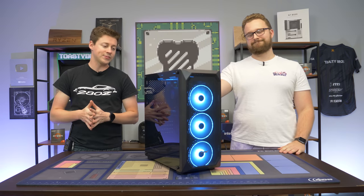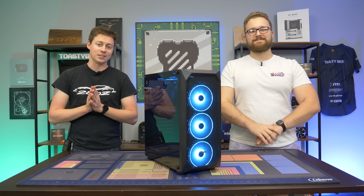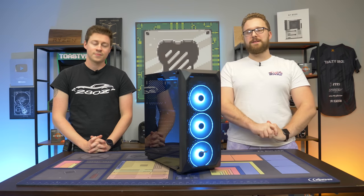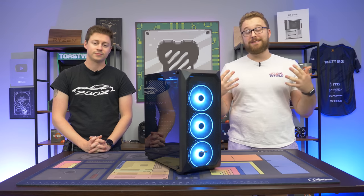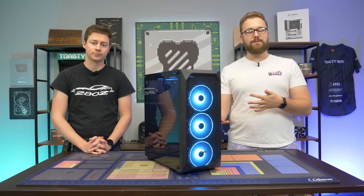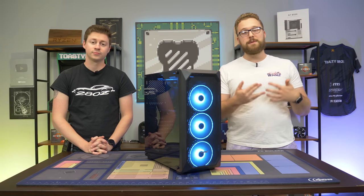Okay guys, so we just benchmarked some pretty basic games in this PC, and honestly, the verdict is not bad for the price, but that Xeon really holds the system back. It is an 8-core 16-threaded processor, but the clock speed of 2 GHz really does hold it back in pretty much any game that is CPU demanding. So for the most part, you probably want to opt, if you can, for something like a 2620 V2 or V3, because the clock speed on that is definitely higher, even though it has fewer cores, it'd be much better for gaming.